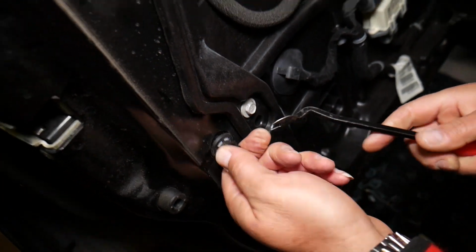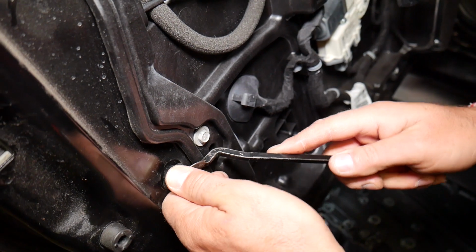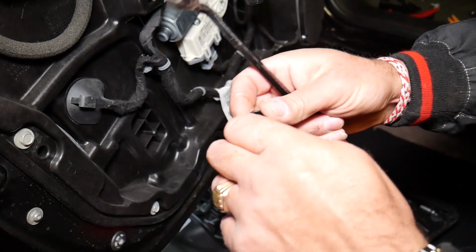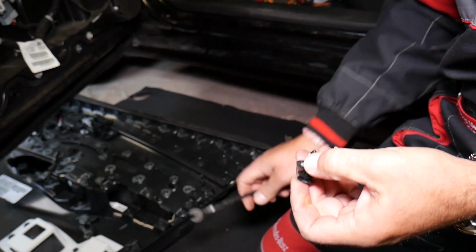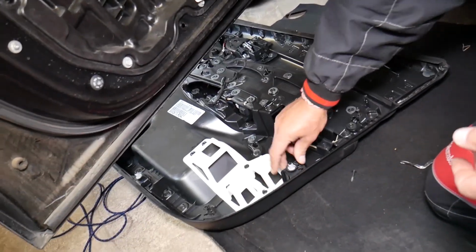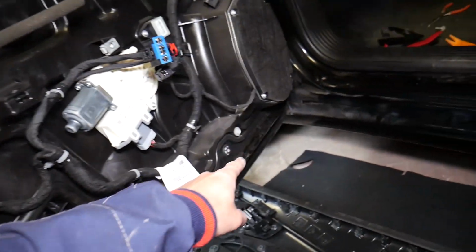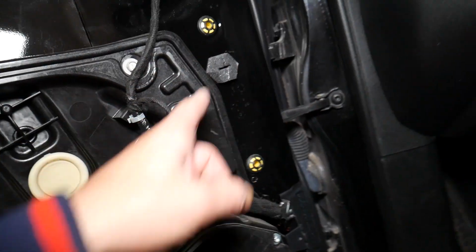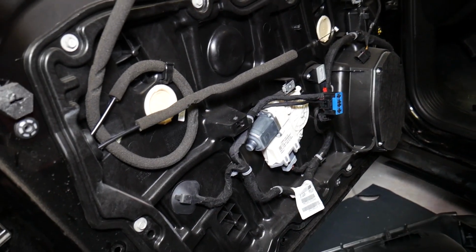No, this clip is stuck, guys, but the two pieces are supposed to separate from each other. Ours just doesn't want to. If yours breaks, like ours did, we'll have the link in the description of the video below, but you get the idea of where all the clips are and what needs to be done. So we have 1, 2, 3, 4, 5, and here around the speaker you have 6, 7, 8, 9, those are yellow. You can see 9 clips holding that door panel and a few bolts and screws.